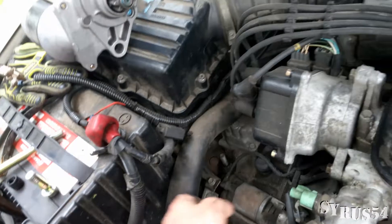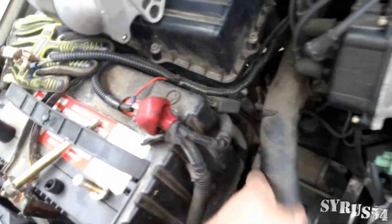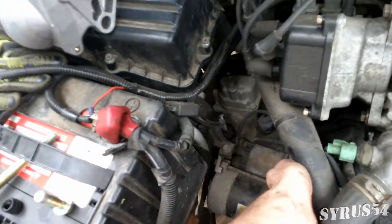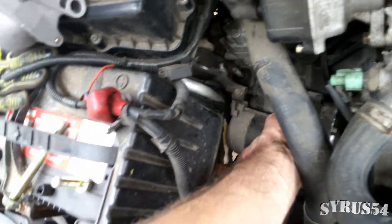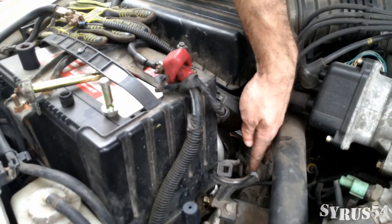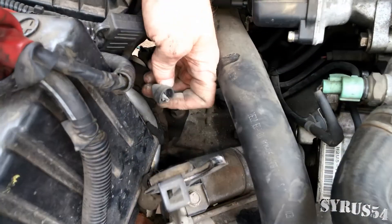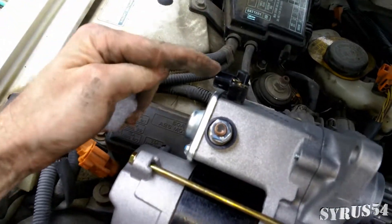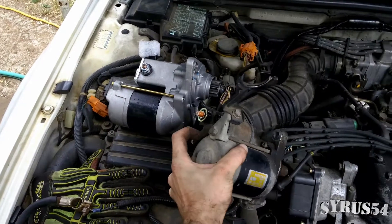Now the starter should be ready to come out of there. Take our radiator hose off of here — it's got this little bracket on it, at least the stock one does; the new one doesn't. While pulling the end of the starter out, I just tried to pull it up and out through here. You've got a little spade connector here right next to your big positive post. On the new one, there's the spade connector and here's the big positive wire that goes straight to the battery. So now we've got the two starters out.